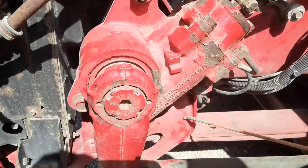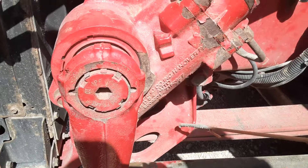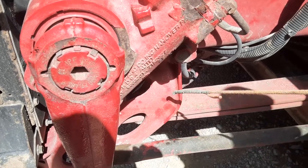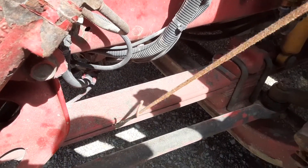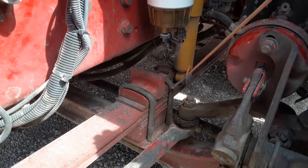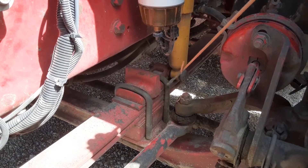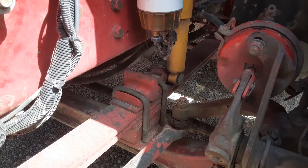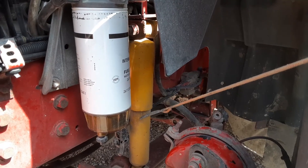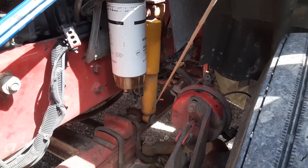Your leaf springs — none are missing, none are broken, and properly aligned. The u-bolts right here — make sure the nuts on the top and bottom are tight, it's not bent, it's not broken, no clean or shiny spots to indicate looseness. Your shock — make sure the nuts on the top and bottom are tight, it's not bent, it's not broken, not leaking, and make sure the bushings are secured where it cannot move.